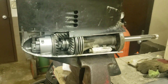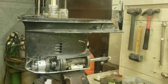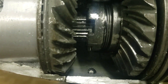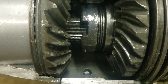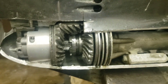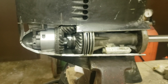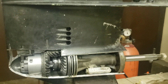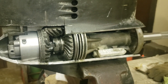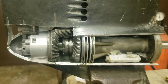I've always wanted to cut one open and watch everything work, so now you can watch with me. I'll show you what I found when I cut this thing open. Almost every gear is broke or chipped. I'm sure all them shavings destroyed the seals, got into the bearings — was not worth rebuilding. I don't know whoever rebuilt it last time did something wrong, probably shimmed the gears wrong. They weren't grabbing right, and it doesn't take much to destroy one of these if it's done wrong.